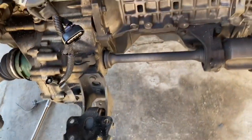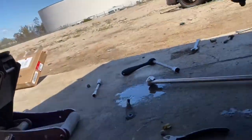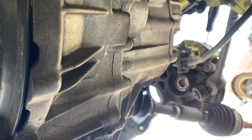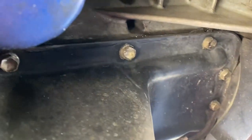Next I'm going to get to the slave cylinder, which is on the underside. I'm not sure of the exact size but it's probably a 12 millimeter — two 12 millimeters to drop that. After that I think we're done under here except for the AC system. I can pull the AC compressor off — looks like it's four 12 millimeter bolts — because we are going to be running the K24 with AC on this car. Besides that hose I'll need to unclamp, I'm going to let it drain from the top, then we can start getting to the radiator hoses.